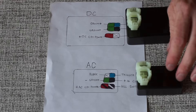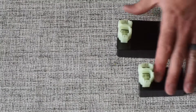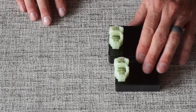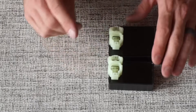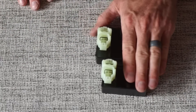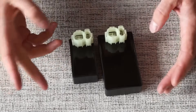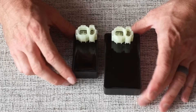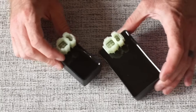Performance CDI boxes — why even get one? A performance CDI box is going to raise the rev limiter or remove it entirely. Most of the time you're limited around 9,000 to 9,200 RPM and then it shuts off — it kills the spark and your motor won't go past that. When you do a performance CDI box, it either eliminates that limit or raises it up to around 14,000 to 15,000 RPM. Different manufacturers have different specs. Not only that — that's just your basic performance CDI box. Sometimes you'll notice they have a little knob you can turn that advances or retards your timing. When you advance the timing you're increasing the performance of your engine. And sometimes on performance CDI boxes they already have the timing pre-advanced.